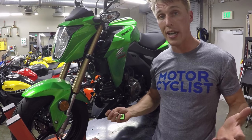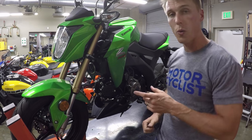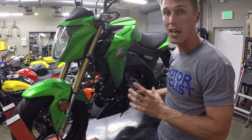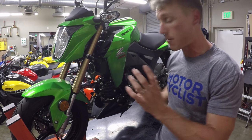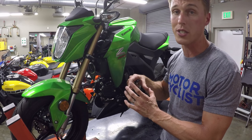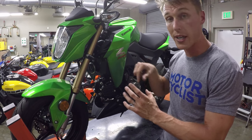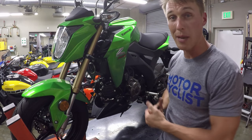DCR cam in, start to finish, took about an hour. The hardest part was getting the cam sprocket aligned, because the engine didn't want to stay at top dead center. Basically what I did was trial and error — kept moving it a tooth at a time, turning the engine back over to TDC, making sure that those alignment marks matched up on the sprocket and on the head. Definitely something you can do at home.